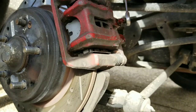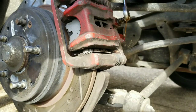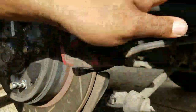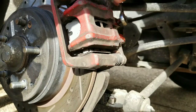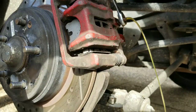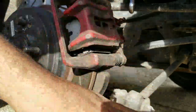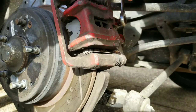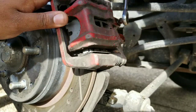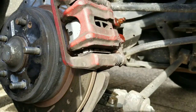I'm going to open up the valve - this is a 10-millimeter. Open the wrench, now just press it to the ground. Okay, hold it to the ground. Locked it in place - now let up the pedal, let the pedal go up. Tell me when the pedal's up fully. Now I'm going to open the bleeder valve again - press it down to the floor, hold it down. Now I'm going to lock it. Let up the pedal, let the brake pedal come up - it's all the way up. Do it one more time - press it down to the floor, hold it, don't let it up. Now I'm going to close the valve. And now let the pedal up.